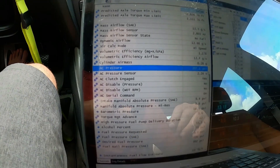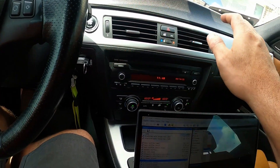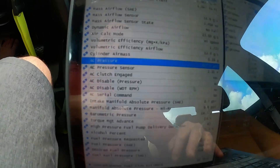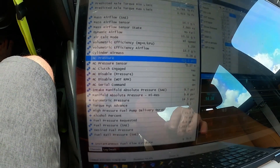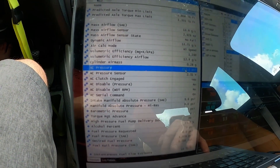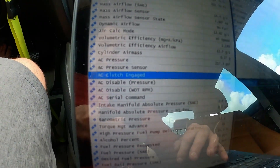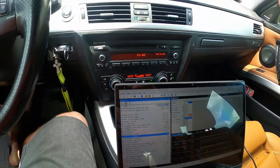Fan control is automatically set up with AC pressure as well as coolant, so our AC is already starting to go full. You can't even really tell the idle change — the factory AC controller works very well. AC pressure control, the high pressure cutoff, wide open throttle cutoff, and RPM cutoff are all adjustable in the tune. The pressure control also cuts it off on the low side, so if pressure is too low it will not kick on the AC compressor output from the ECU — you can see right there the AC clutch output.